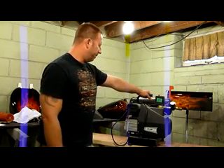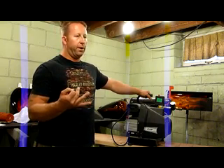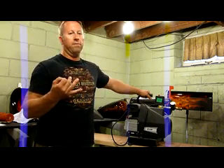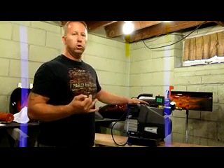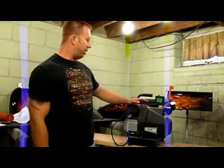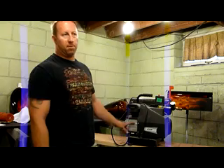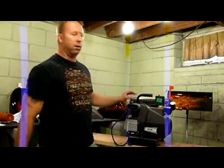There are three different types of compressors: you have oil-free, you have oil-lube direct drive, and you have the belt drive oil-lube. The oil-lube means that you actually have oil in the crankcase of your pump — it's kind of like an engine or a piston and all that kind of stuff.